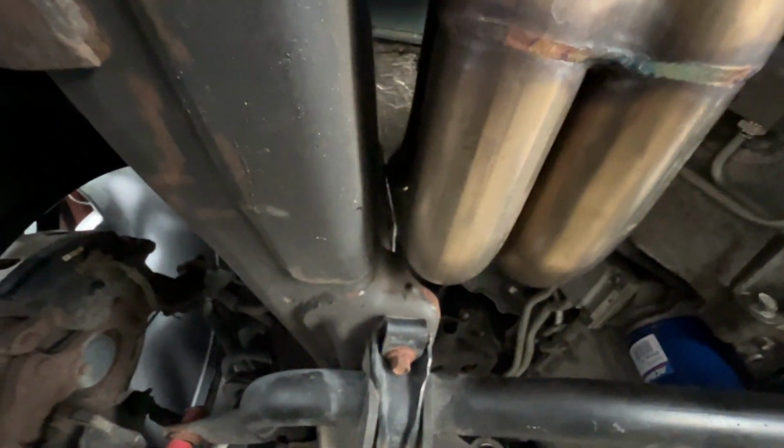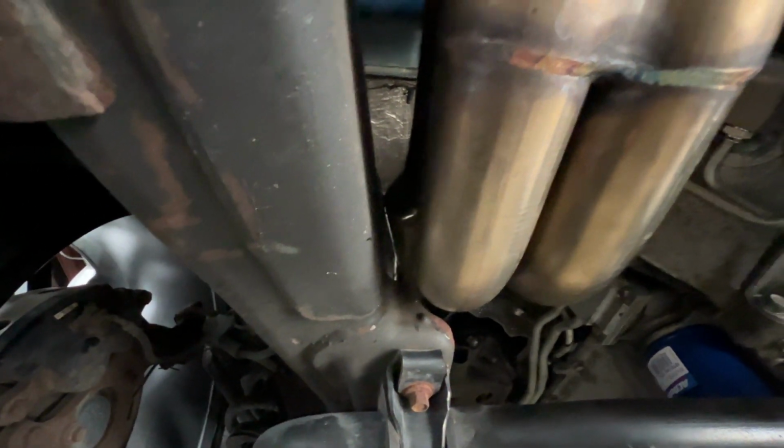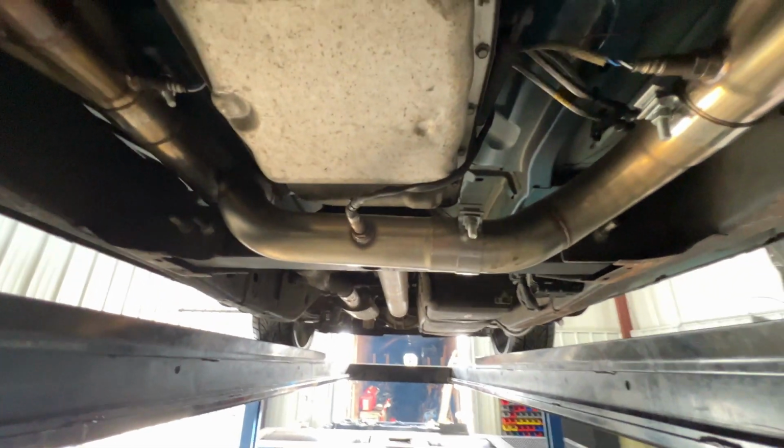Front tires are good. Headers are clear, it looks like. Maybe touching just slightly, like right there. So I have to watch knock sensors there, make sure they're not setting off something false. Headers are clear over on this side. You guys can kind of see. I mean, you can just barely see light between there and the frame rail, but it's already got a wideband bung, so we'll put mine in there.